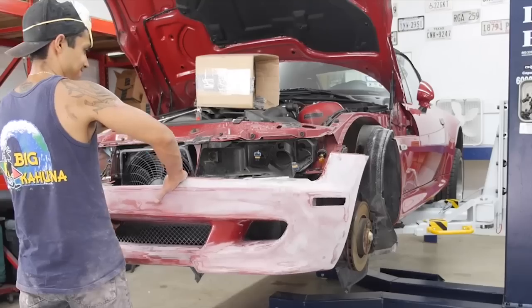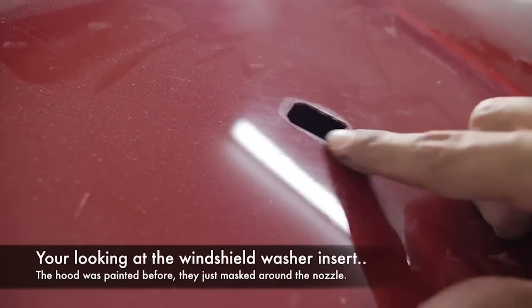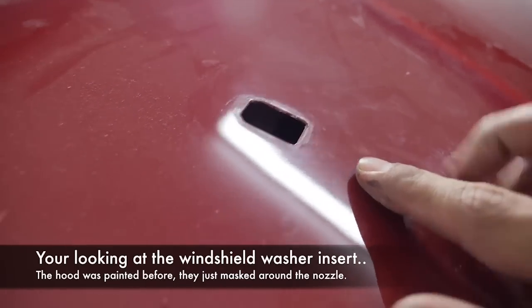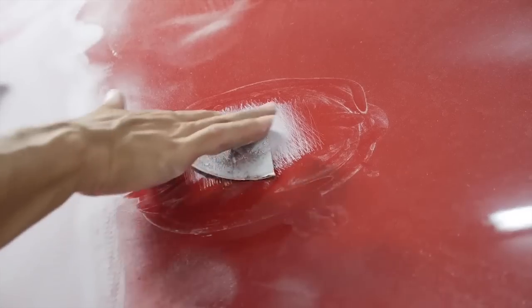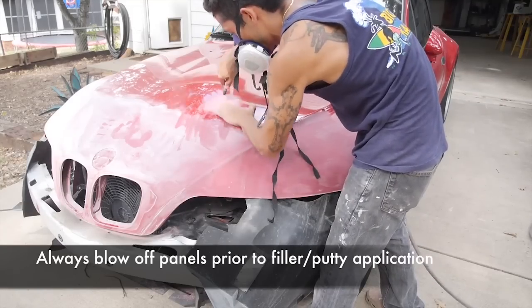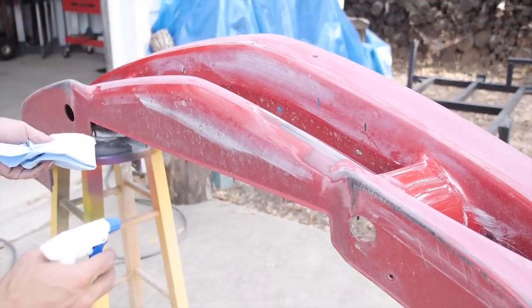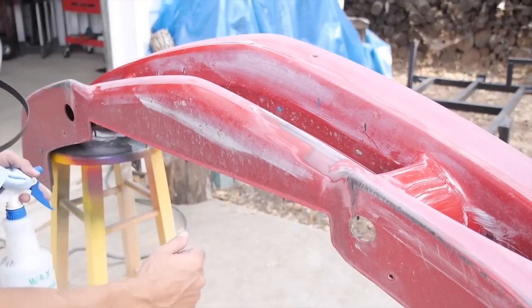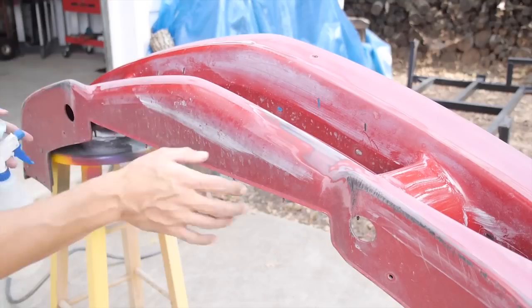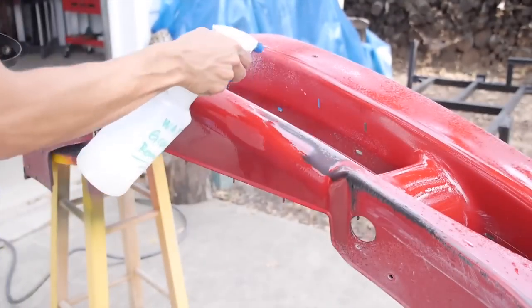You can see the hood was painted before — they just masked around it because you can see some of the new clear coat build-up, so we're going to sand this area down. This dent right here is so small that I'm just going to scuff the area with 80 grit by hand. It's always important to blow off everything, even under the hood — you don't want dirt ending up in your paint job. I like to spray degreaser underneath, hit it with a brush and wash it all out clean, but just for this example I'm going to use wax and grease remover.